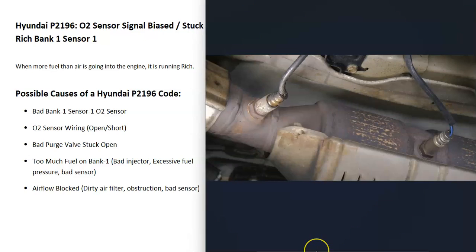And what does this mean? Well, there are sensors located on the exhaust and they do two things. The first thing they do is monitor the catalytic converter. The second thing they do is read how much oxygen was burnt off during combustion, and then they send this information — the air fuel ratio mixture going into the cylinders — back to the computer. For some reason, this bank one sensor one is reading a rich condition, which basically means there's more gas than air going into the cylinders, so it's going to require troubleshooting.